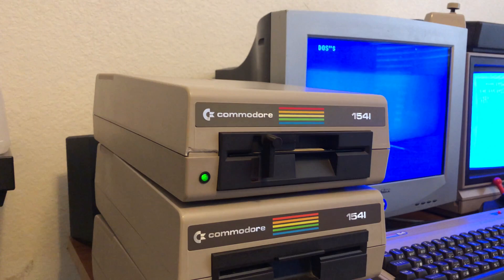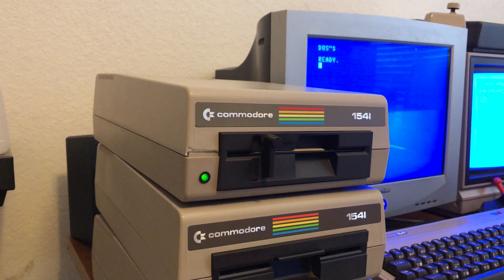When you go to read the directory of your floppy and you start getting that red light flash and then that error light flash, most likely that means the read head is dirty and just needs to be cleaned with a q-tip.